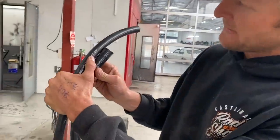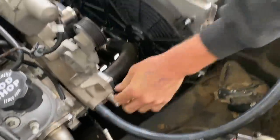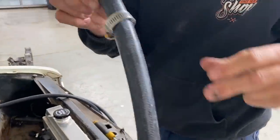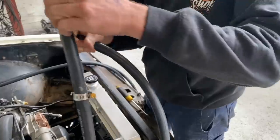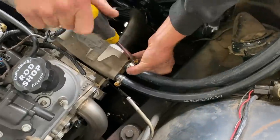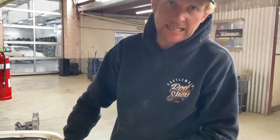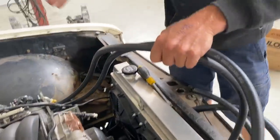We'll just lay the hoses over the front there. What we're going to do is hook up the larger size fittings on the other side where they go to the motor. We've got our three-quarter and our five-eight hoses — we'll push both of them on. They are super tight. We'll bang some hose clamps on them. Then we'll grab our two reducing barbs to get it back down to half-inch, feed them underneath the radiator, get a nice spot, place the half-inch hose where we want it, mark it, cut it, put them all together, hose clamp them — that's the heater system done.